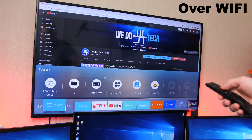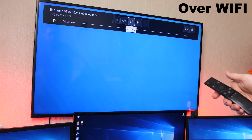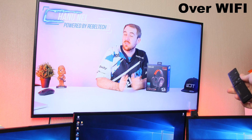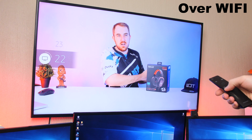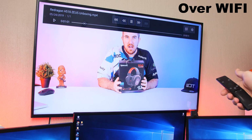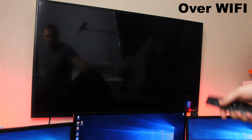However, even without the Plex, you can still connect the NAS to your PC, TV, phone, tablet, whatever. You can access all of the files super easily. Now, as for the media consumption, if you wanted to watch movies in 4K, the DS418Play does support transcoding of 2 channels of both H.264 and H.265 at the same time, which is going to take the load off your TV or your other devices for a seamless playback without it needing to transcode everything.